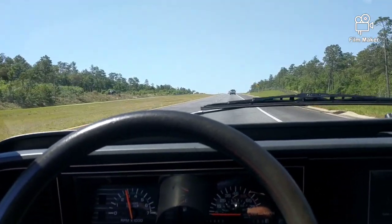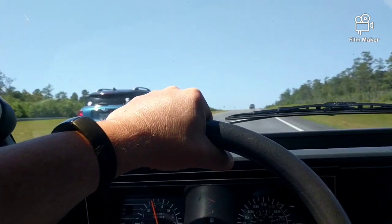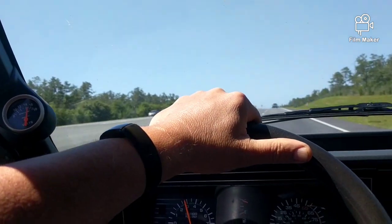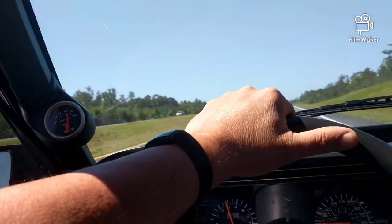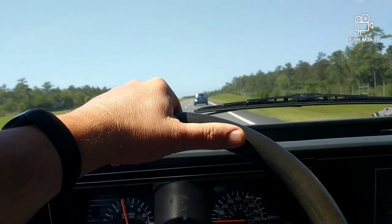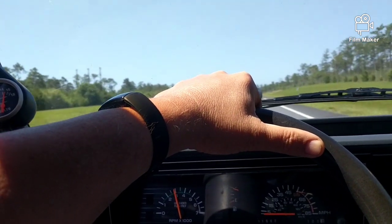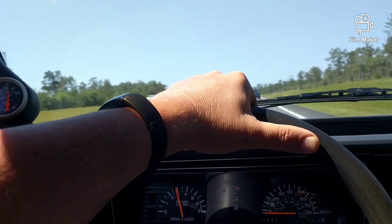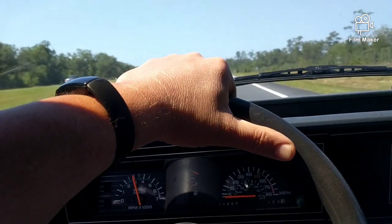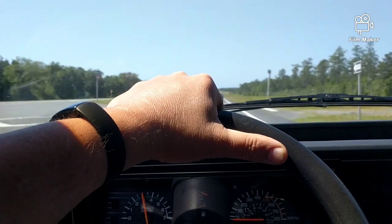It's running a lot better. I had some issues with the mass air meter - the old reliable 92 millimeter Pro-M - just had something wrong with it, I think I dropped it one too many times. I put a slot meter on it and it seems to be working a lot better. I've still got a bunch of other issues with it, like the number one window decided it didn't want to go up anymore today, and the speedometer - I put a new speedometer cable in there and the back of the speedometer housing broke off. The old cable bound up and sheared off some of the teeth on the driven gear off the tail shaft.